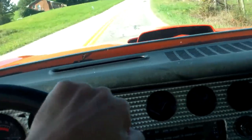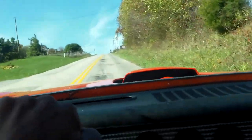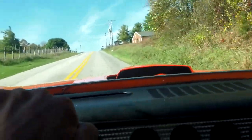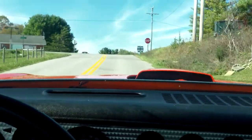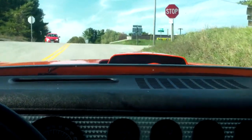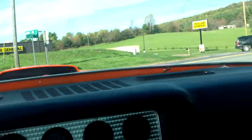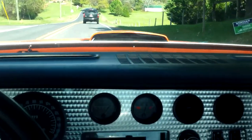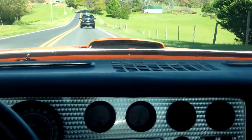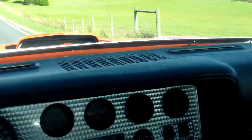Now, my particular car has been modified mechanically. You can probably tell by the way that it accelerated better than a stock 76 Trans Am. It has a fairly modified 455 with ram air style exhaust manifolds. Pontiac was one of the manufacturers that actually offered a performance exhaust manifold from the factory. It's sort of like a cast iron header. And this engine has that. It's also got a fairly aggressive camshaft.